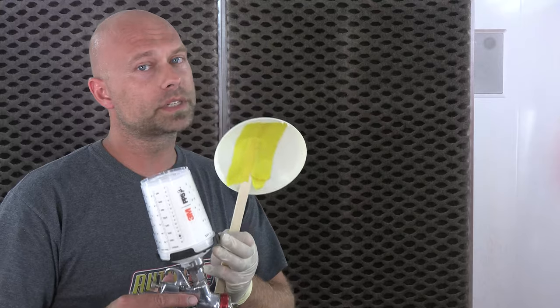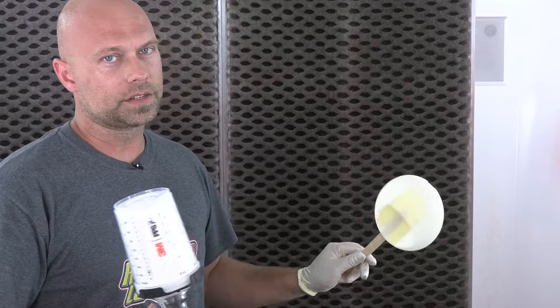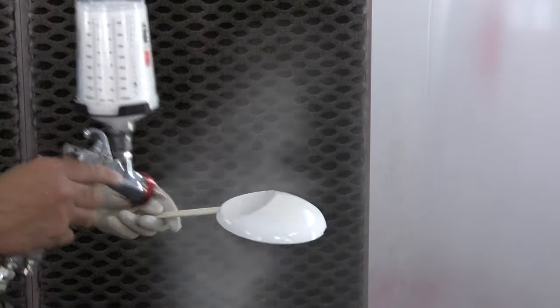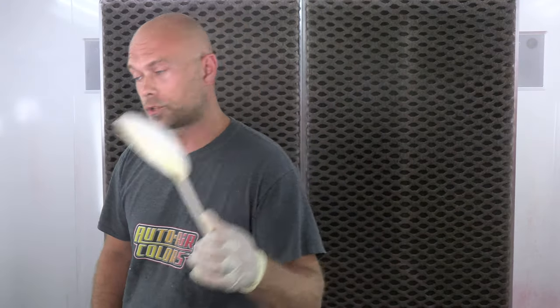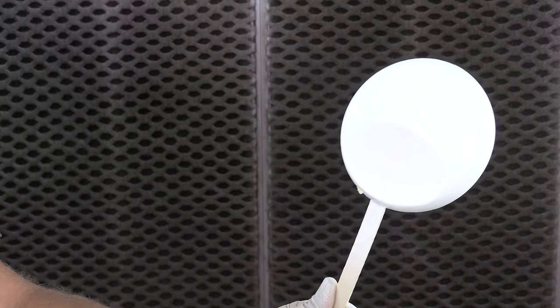These are all actually reduced the same way — I'm mixing this about 10% with our 4011, so that silver sealer was mixed the same way. This is our sealer white going down exactly the same. Nice medium wet coat, that's all I'm looking for. Nice even texture and it's going to dry really nice. You don't want to really pound this on, it's just a medium wet coat. So I'm going to go ahead and spray my other shape while this one's drying, and that's exactly what you want it to look like.